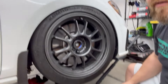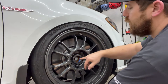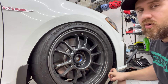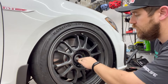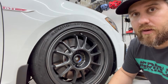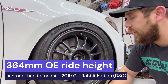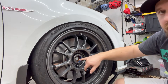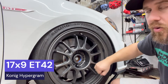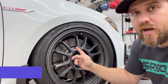I have jacked up the lower control arm so that we can find out exactly what our hub measurement from here to the fender well is, and find out what our maximum bump travel is in relation from the hub to the fender. I measured it at stock ride height with the weight of the car on the tires, and that measurement was 364 millimeters for my 2019 GTI Rabbit Edition. With my 245-40R17 Kumho V730s on 17x9 Konig Hypergrams, we are looking at 291 millimeters from here to the fender.